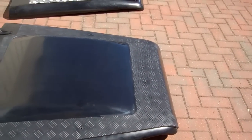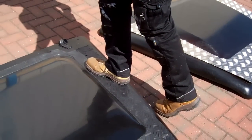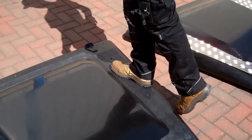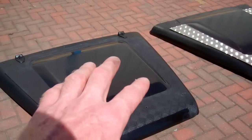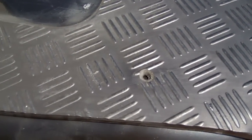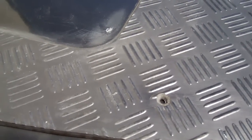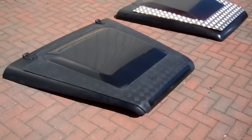We're going to have someone stand on the fiberglass to test if it will take the weight. The bonnet's creaking a bit but the fiberglass is perfectly strong enough - it should aid your access onto the roof, but don't try standing on the bulge area. We've put countersunk holes in so you can bolt it on - we'll supply it with countersunk bolts. It's also worth putting a bead of silicone on there to stop it vibrating. And that's the Defender bonnet options we've got for you today.